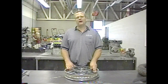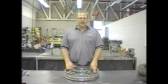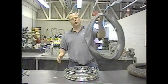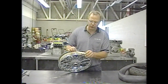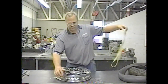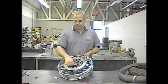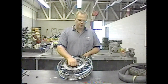This video is going to show you the proper way to lace a typical motorcycle wheel cross two spoke pattern. Before you start, you need to remove the tire using the tire machine, the tube, and the rubber band that protects the tube from the spokes. You'll also need to remove any brake rotors that may be installed on the wheel, and sprockets if you're working on a back wheel.